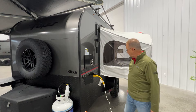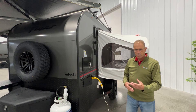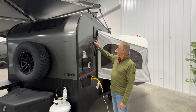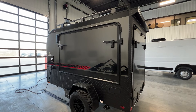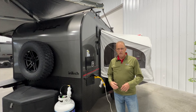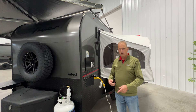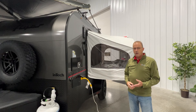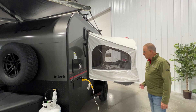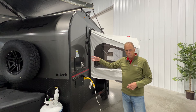Notice the ATP we've got on the bottom of the trailer. It gives it a nice rugged look, but also serves a purpose because the last 24 inches down is where you could get the most nicks and dings, so it does a nice job of keeping that protected. You're also going to notice vents in the trailer — one up high in the front and another one at the back of the trailer down low. Those are designed so that if you've got a side-by-side, a motorcycle, or any gas-powered vehicle inside the trailer, you can keep those open going down the road and it'll help keep the fumes outside. You're also going to notice the big tip-out here on the road side of the trailer, which is standard on the Explorer. It is rated for 1,100 pounds. There is also an option for a second tip-out on the curb side of the trailer, though you would lose your side door on the curb side.